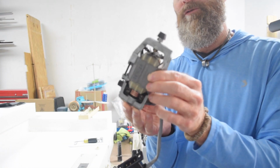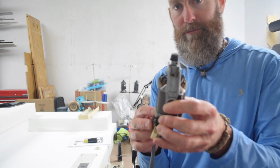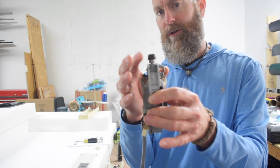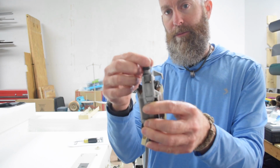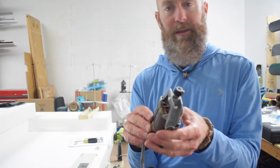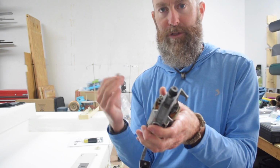into this one. This is the motor from the 801, and interestingly, or at least interestingly to me compared to the machines I'm accustomed to, this engages the hand wheel on the motor by friction. This rubber wheel on the shaft of the electric motor just rubs against the hand wheel, and that's how it drives the machine.